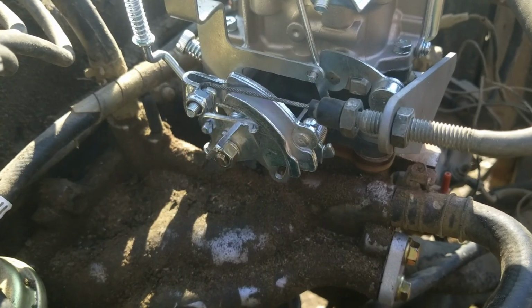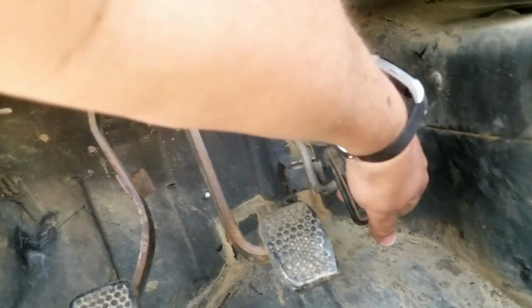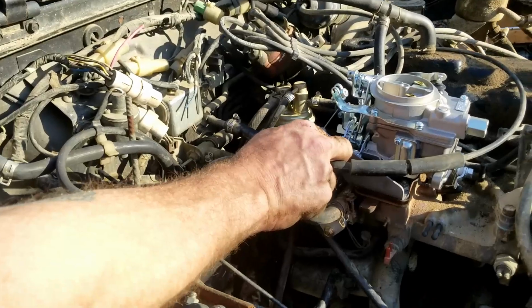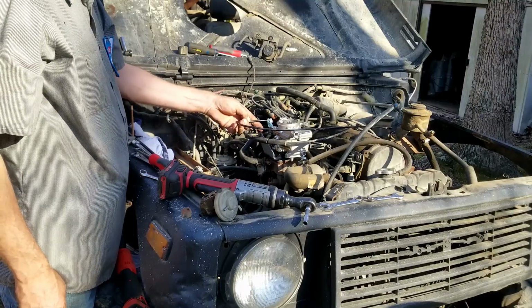If the throttle does not travel enough, grab the foot pedal and pull it upwards towards the steering wheel. The small foot pedal arm can be bent over the years and limit pedal travel. Pulling it out will restore or increase travel. Adjust the throttle cable at the new bracket to achieve proper operation. Cable may now be threaded onto the carb bracket. This comes with the carburetor.